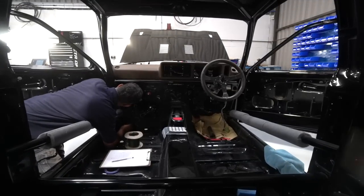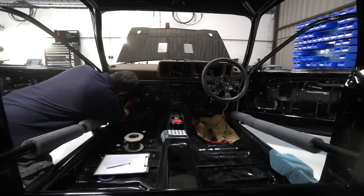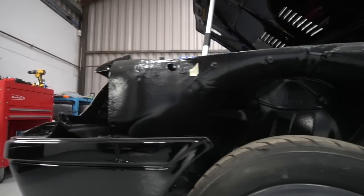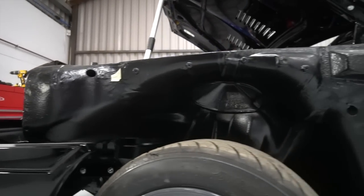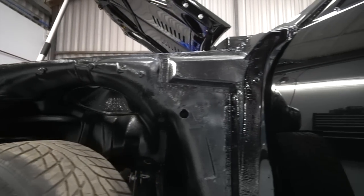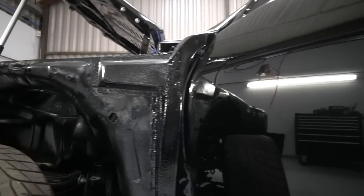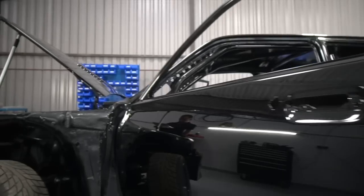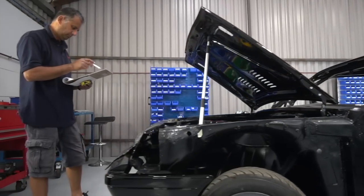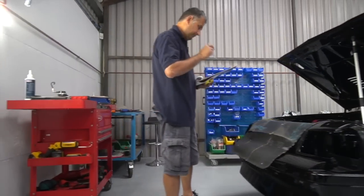As is always the case, we kind of planned the wire routing when it was at the metalwork stage. So for instance, the reason this wing is removed is because there's a wire routing down here, comes out from the PDU, which is mounted on the inside of that kick panel, through a grommet here, along these bosses that are welded to the wing, back in through this grommet. There's bosses across the front. So all of the wire routing has already been planned and provision made for it.